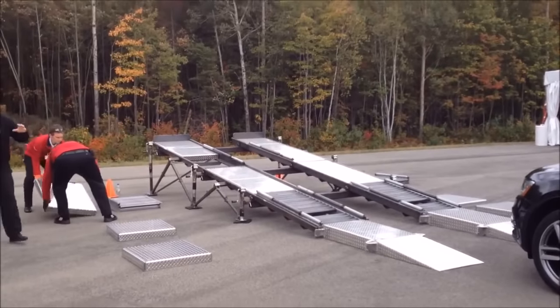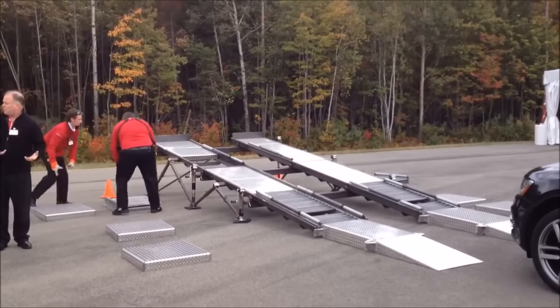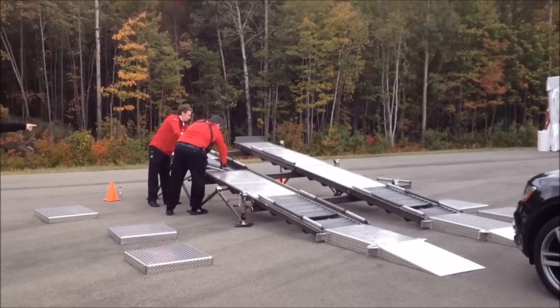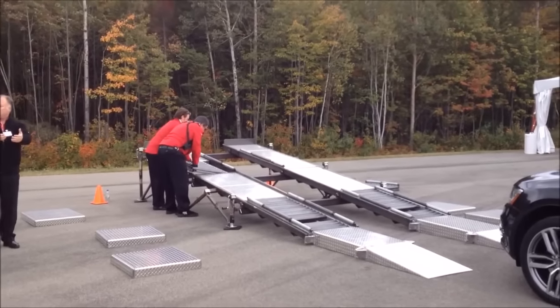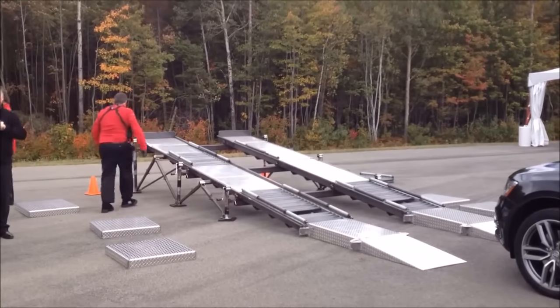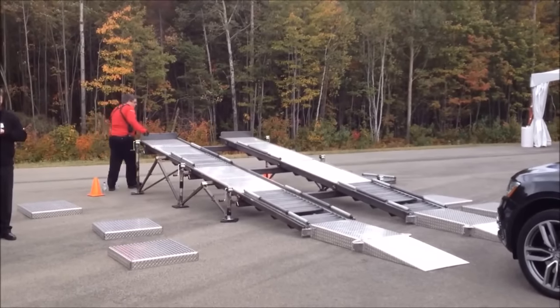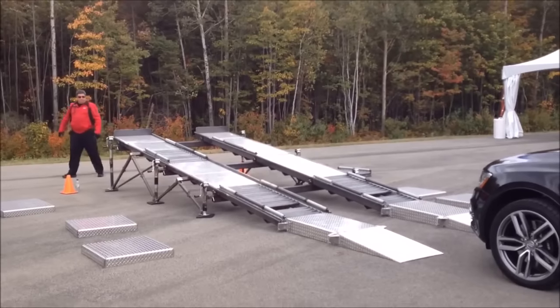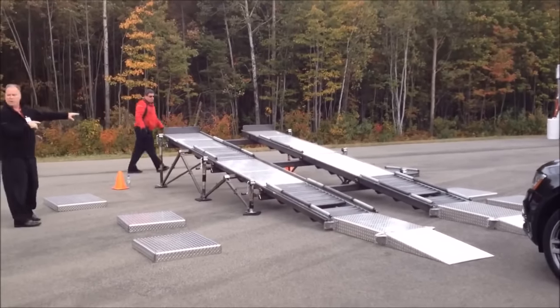So we're going to actually crank at the rear, right, where 60% of our torque is going. We're going to nullify that. And then up front, we're going to create where Quattro is going to transfer more torque to the front. It's going to get to the center, to the front differential, and then it's going to look left and right. It's going to say, what's easier, move the car or just spin the wheel out?